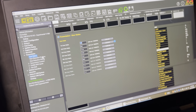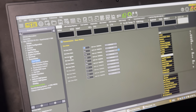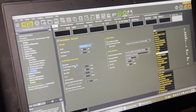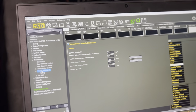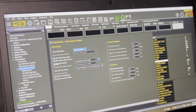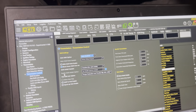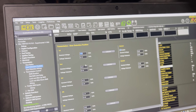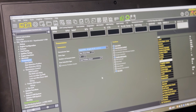It also knows the wheel speed — the drive speed — so it can calculate what the RPM will be in the next gear. For example, downshifting from fourth to third, it figures out the RPM in third, meets that RPM, and sets basically a moving rev limit, which helps make downshifts nice and smooth. Here are the paddles. You can enable shift stacking — I have that turned off right now. You can set up a lot of safeties, shift inhibits, and your own tables. Haltech does a really nice job giving you control. Gear detection is my barrel sensor — it knows when it's in first, second, third, or fourth.